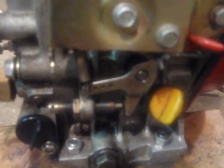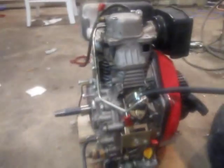So that's the maximum fueling it can do — this is the maximum fuel screw. After it hits here, it can't fuel any harder. If you screw it out, you can only screw it out to a certain point, otherwise the shaft won't come out anymore. You can screw it up until its maximum point, in which case when the engine comes under load it will fuel as hard as it can, but you don't really want to do that. You don't want to set the fuel to maximum because on these naturally aspirated engines, you only put as much fuel as can be burned — maybe a little bit more to get maximum power output. The only case you'd want to turn the fuel up on these engines is if you had a turbocharger on it, because then it could actually use the fuel and turn it into power. Otherwise it's just raising your EGTs and cutting engine life for no reason.